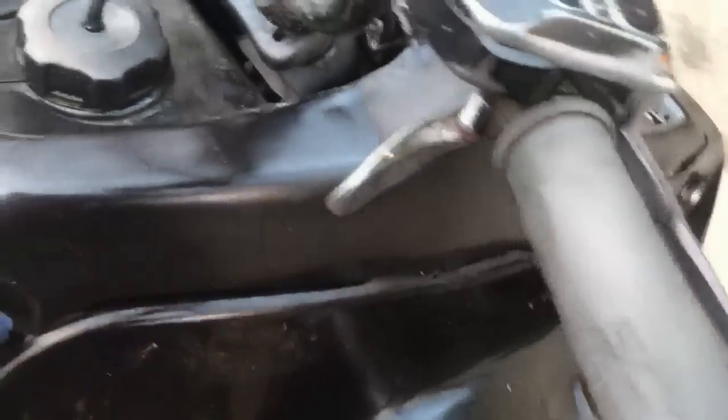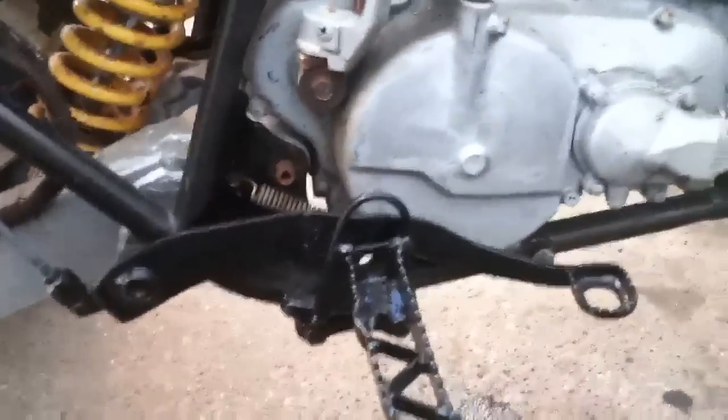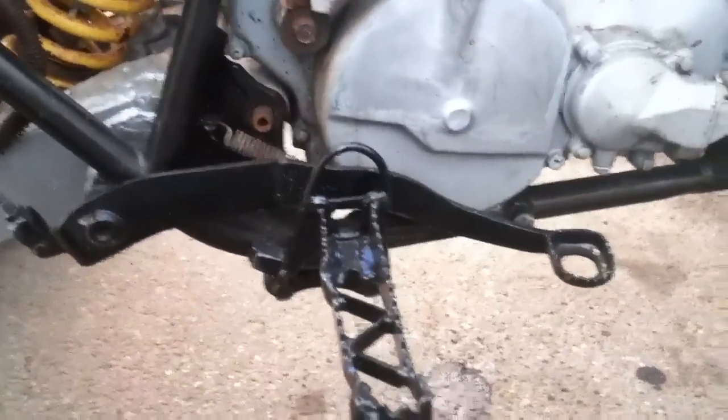I'm just running out a little bit of gas. It's got a minor oil leak I gotta fix. I still think it's the clutches. I drained the oil — if you guys saw the last video, barely any oil came out. I put 1056 milliliters in it because that's what it calls for, and it looks like it's running.